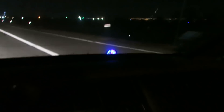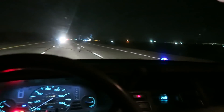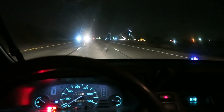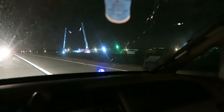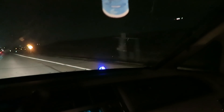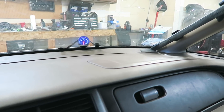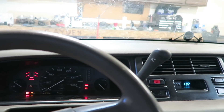Driving back home now, the oil pressure is just under 50 psi, which is pretty good. It's kind of weird because it wouldn't come over 40 psi on the dyno, but now it's just under 50. It still won't climb any higher than that as the RPM rises, and it should be climbing. Brent told me about 10 psi per thousand RPM is the general rule. At around 50 psi it just stops even as RPM keeps climbing, so either the oil pump is worn out or I might have put something together wrong. At least 50 psi cruising is still plenty — it's safe to drive. Next day: we have the gauge taped to the windshield and we're taking it around the block to double-check the issue.